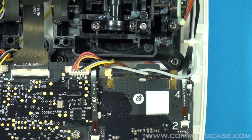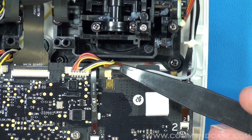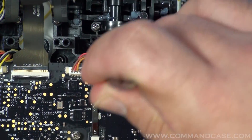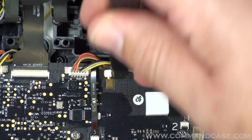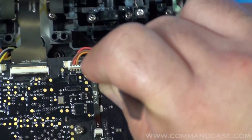On the middle of your controller on the right side, you'll notice these two antenna connectors. You're going to want to remove these — they just push straight out if you can get your nylon pick under the head.